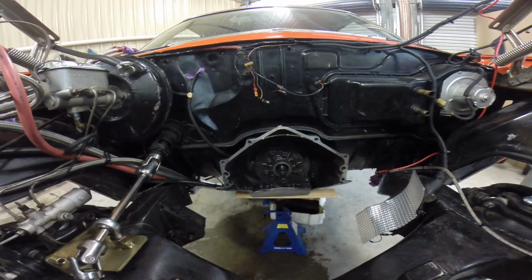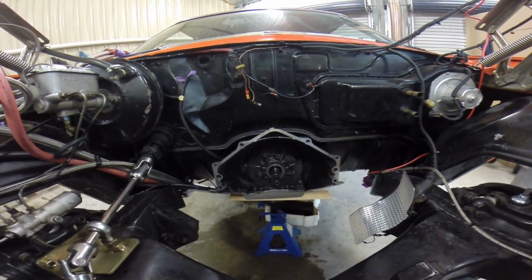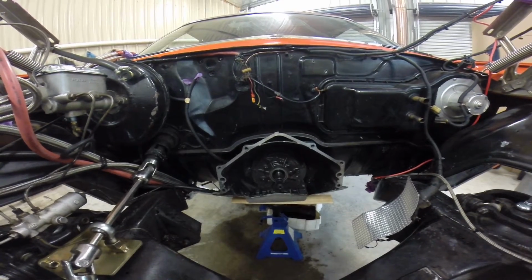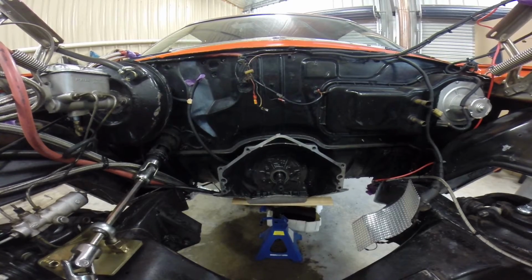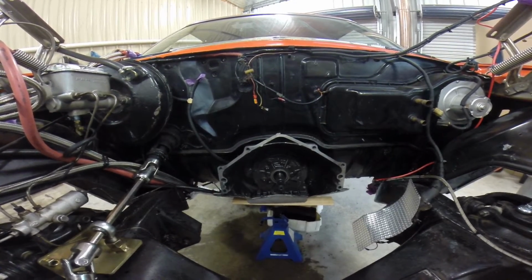It's looking like, at the minute, the early stages are, it's line pressure that's hydraulicing the converter back into the engine. So I have to learn a bit more about that and delve into it. But I'm sending the converter over for analysis, basically to determine what was going on with it, and hopefully we can get it all sorted and correct it.